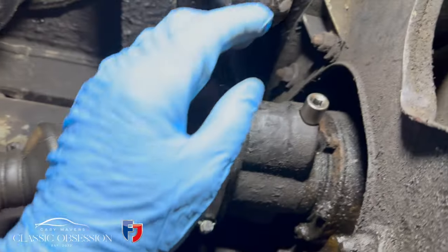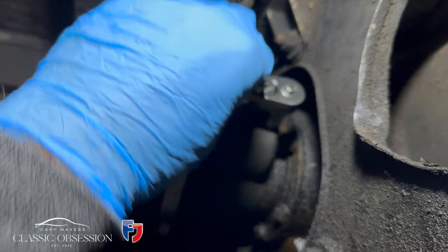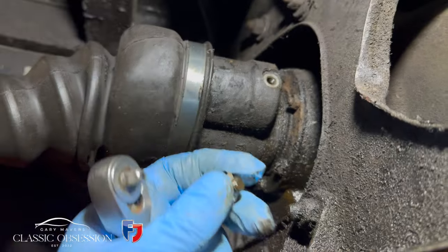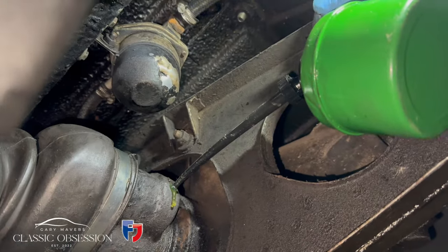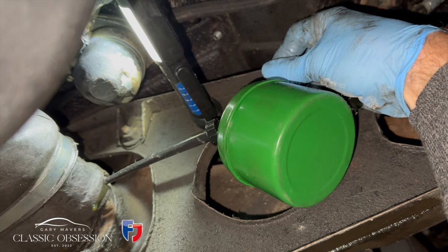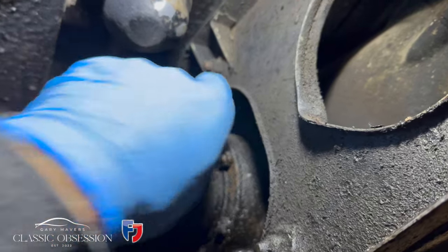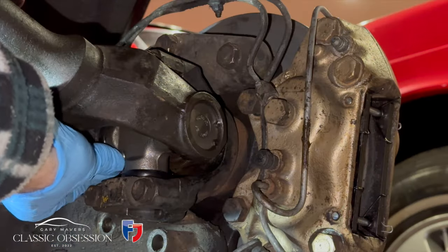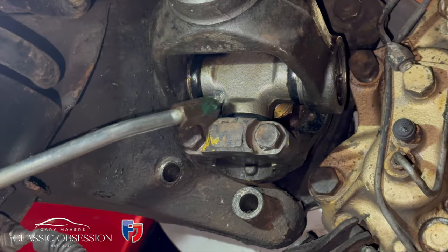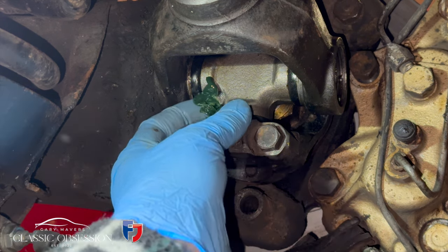Now when the short axle is back on, just open up this little filler cap and like a contortionist just spray in maybe 20 or 30 squirts of EP90. I think this is lubricated from the diff itself — I think there's a hole that goes through to it — but just keep it well lubricated. It's also a good idea when you service the car to go around all the little grease nipples and lubrication holes and make sure everything's got a few squirts. And of course when that's all back together don't forget to grease up the UJs — a good indication is when the grease comes out of the rubber seals.